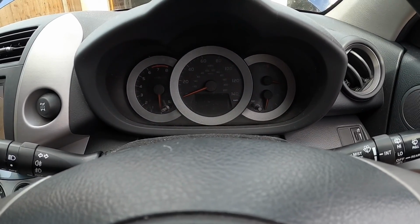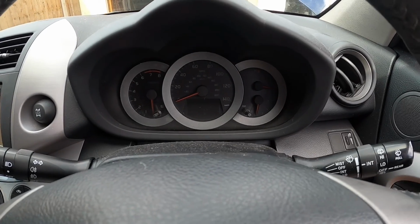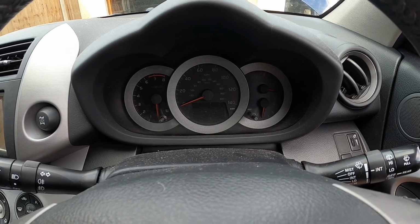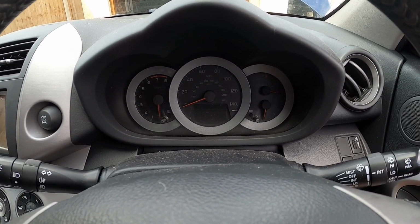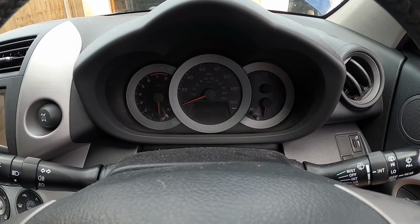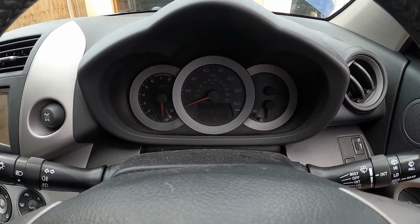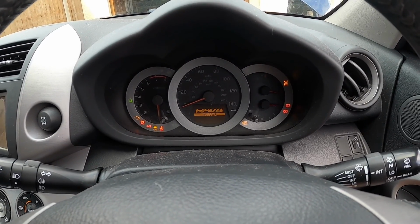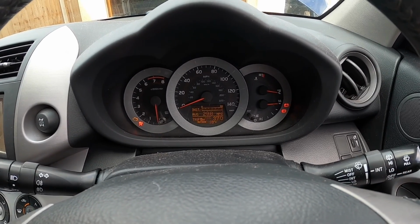Okay, so the oil filter is not loose but loosened, so it will come off, and I've just checked the tightness of the sump plug, which I've cracked and then just nipped back up, so now I can get that off once the engine's hot. So let's just start her up and make sure that she runs okay with the new plugs in, which she should do.